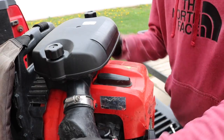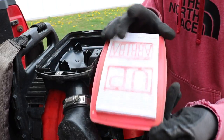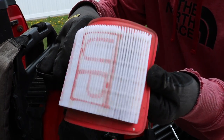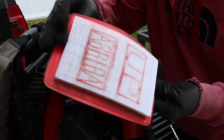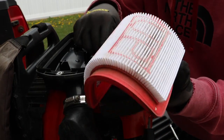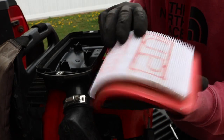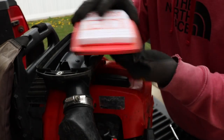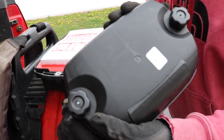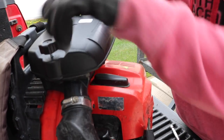Let me show you how to change the air filter — it's the simplest thing you can do. Most of these are about twelve to fifteen bucks at your dealer. This one's looking pretty nice, doesn't have any debris on it, and this is actually from a whole season. A lot of these get torn up with grass all over them. You can take high-pressure air and blow it out, but for ten or twelve bucks it's not bad to replace one annually. It goes right back in on top — put your lid back on, tighten it up.